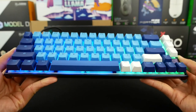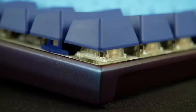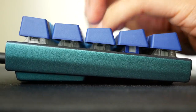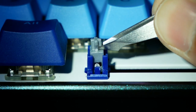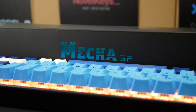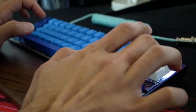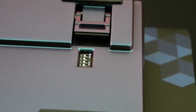All right, so final impression time. I truly enjoyed my experience with this keyboard. I personally feel that it's performance-oriented and caters very well to gamers and typists. Bottoming out can be a bit unforgiving, but because there's virtually no give, I'm able to push off the keys and input other commands very quickly. Even the stabilizers appear to be geared for performance — I took off the keycaps for a closer look and there's definitely some lube present. It's a light coating, just enough to help smooth out the overall feel without making the stabilizers feel sluggish. Just like the RGB customization, the Mecha SF can also record macros onboard with no need for any software. I remapped page up and page down to home and end respectively, and now the Mecha SF is great for gaming and my workflow. The bottom of the keyboard features a set of four dip switches.